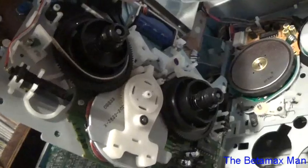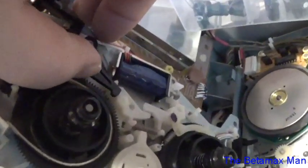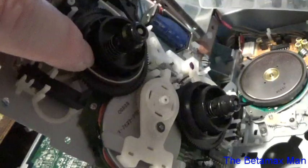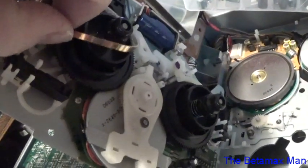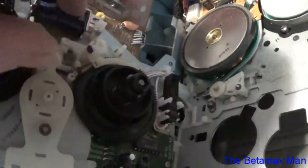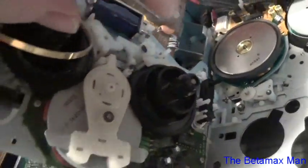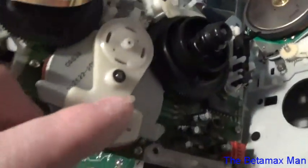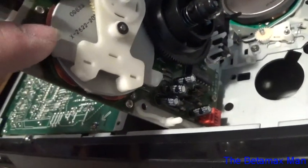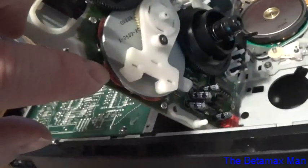What you want to do is pull back this black plastic spring-loaded part. You pull that back, and then you take this — this is your belt, your brake system. You just simply lift the brake up like that and it'll come off. You move the black thing and take that reel off. Over here you've got another brake — you just move that back out of the way and you can remove that rear reel. Then you take this little cut washer off, and you'll have this plastic pendulum gear that swings back and forth. That can come off and then you can actually grab both sides of the motor.